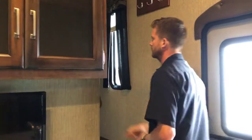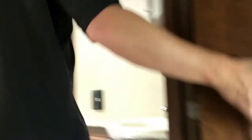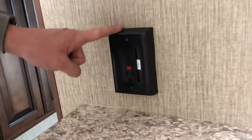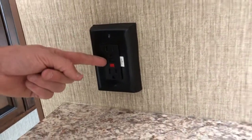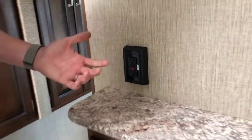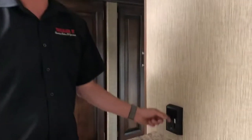Follow me up here to the main bathroom area. You've got a GFI power outlet here — just like the ones in the bathroom in your home with a test and reset button. The only difference in an RV is that it's wired through all of your power outlets. So if you're plugged into power and you're not getting any power from your outlets, you can come in here and try the reset button — that'll reset the whole system.